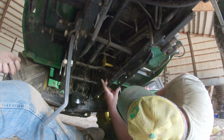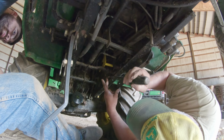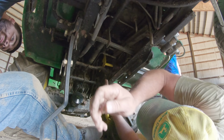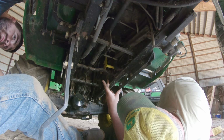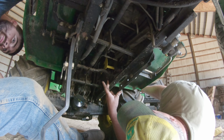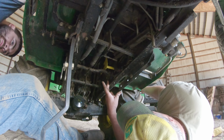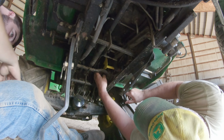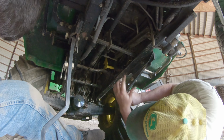I think we gotta pull in your hydraulic lever, see if that'll relieve the pressure. Going both ways with it. And have to start it up. There, right there. Pull it back there a little bit. The other way. Take it back the way you were going. Start off. Pin's got to come out there, see? I think that's what's bound up, is right there.